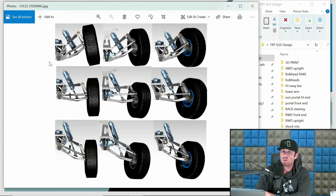The reason I like to use these terms is that you do not want to necessarily interchange them with bump and droop. That would be kind of inappropriate from an engineering standpoint. So when you're saying compression, you are referring to it actually being compressed, like full compression. When you're saying extension, that would be extension on the bottom side. If you go to the shock manufacturers' websites like King Shocks, they actually denote the shocks in that fashion as well. So again, it's more of an engineering terminology.